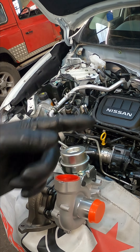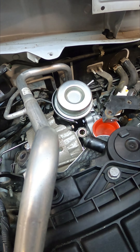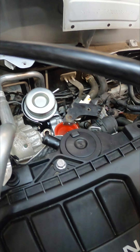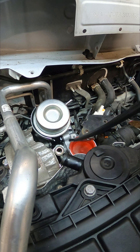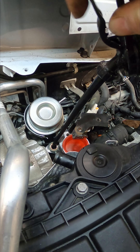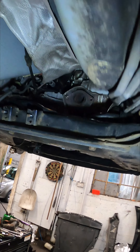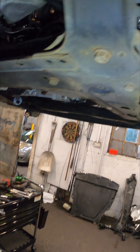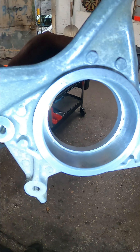Let's get this turbo fitted. And there we go, that is the turbo back on. We've got the DPF back on - it's an absolutely horrendous job. Now, get your oil can, and before we put this banjo back in the turbo we need to prime this as best as we can - just get plenty of oil squirted in. Back underneath the car, I've got the oil feed pipe up there to tighten up and various brackets, and I've cleaned that one up which secures the driveshaft bearing.